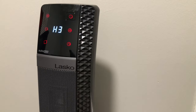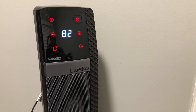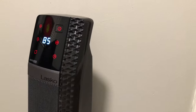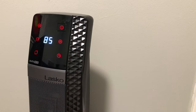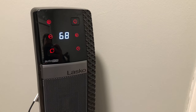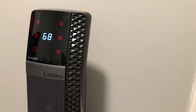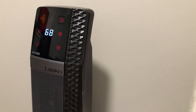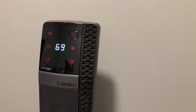We're going to increase the temperature — let's go up to 85°F. It goes all the way up to 90 but let's set it to 85. What's going to happen now: the temperature is going to set in, stop blinking, and the fan kicks on. It will start raising the temperature from where we're at — around 68°F. When it gets within about two degrees of the target, the fan will kick down to low, and once it goes two degrees above that temperature, it will kick off.